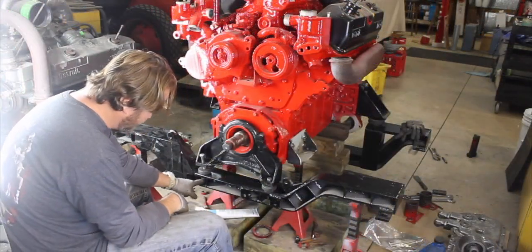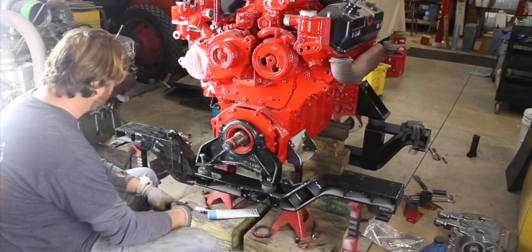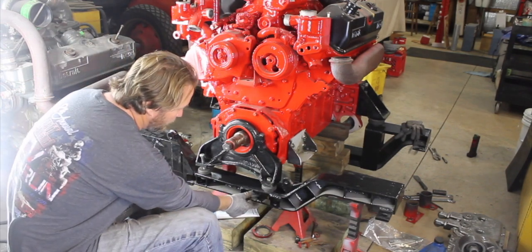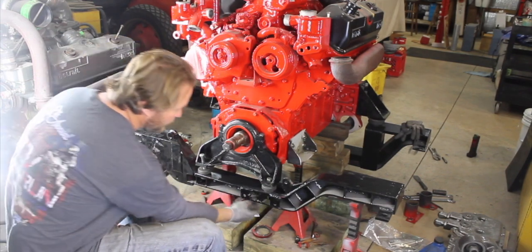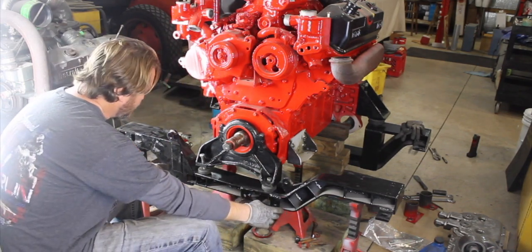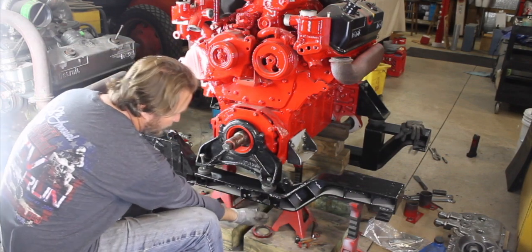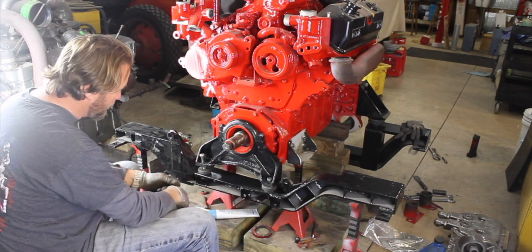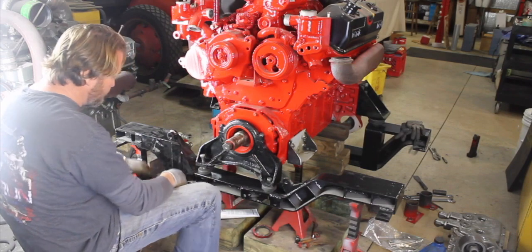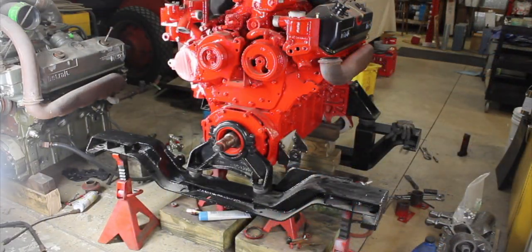It was hitting down here. I also had this motor mount on backwards. I had to look at it for a while, and then I remembered there was a plate welded here. I torched that off so I can get a wrench in here, because you couldn't get a wrench in there, and the guy that had it made a thing for a hitch, and that was in front of this, and you couldn't get underneath, so I plasmaed out a hole in the bottom. This one I didn't touch, so this bolt has to be the right length. So I'm gonna try to measure that and find the exact bolts.